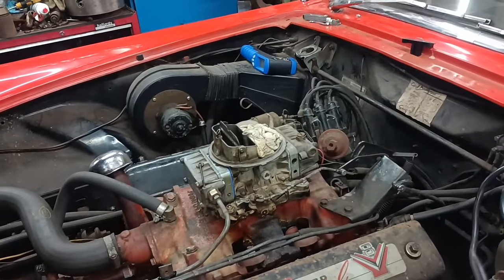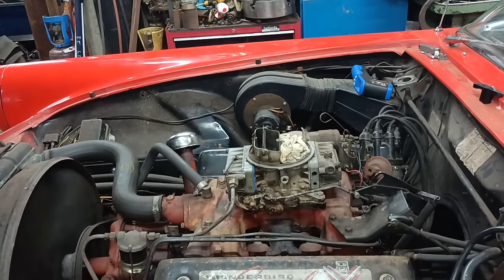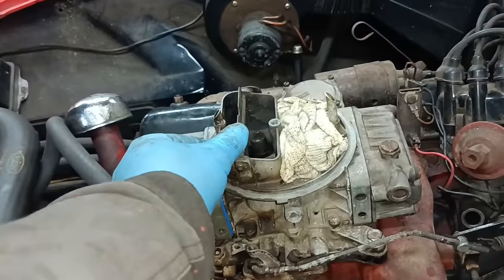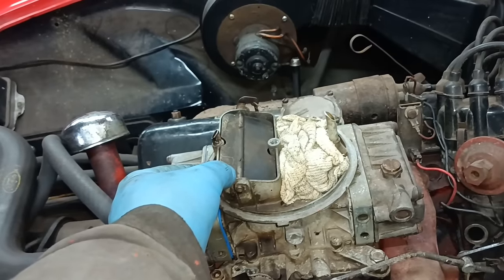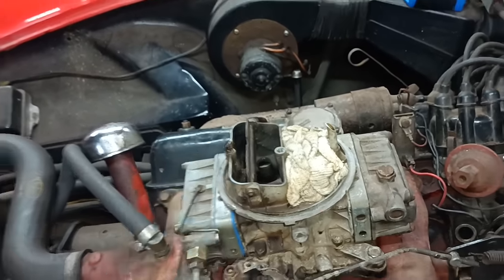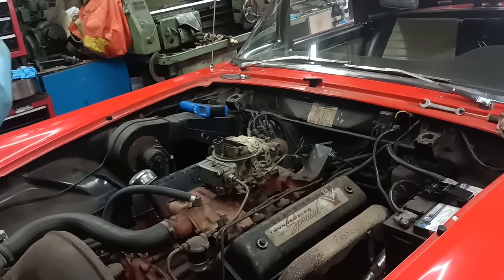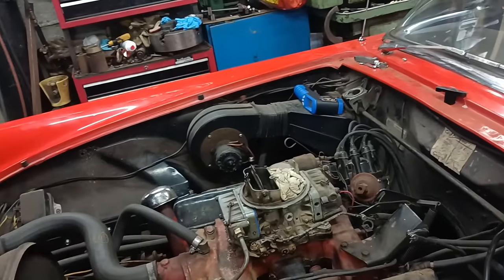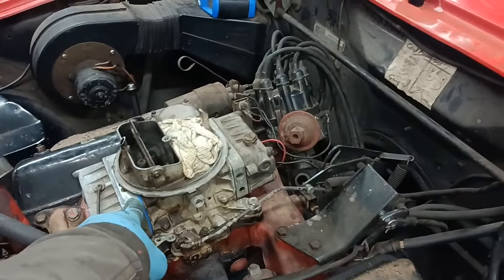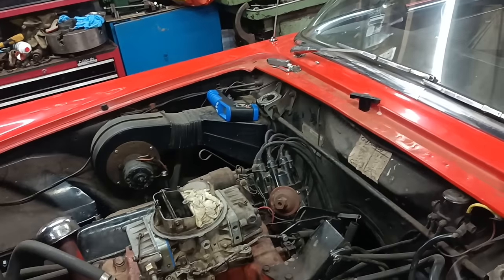Okay, I think that's running okay. So I can't film while they're making that racket, can I? Okay, I think that's running okay. Now before, when I did this, it used to speed up. Now, that went rich then and started slowing down. Okay. Well, that's a lot happier, isn't it, than it was. Still not perfect, but it'll be interesting to see what happens when I hook the second side up, because I don't have the modern equivalent of that to go there. But this side doesn't need an idle circuit.